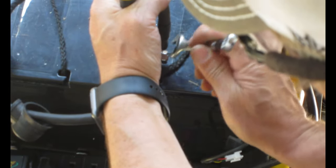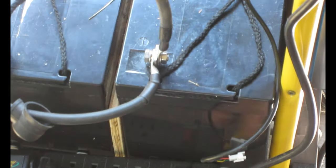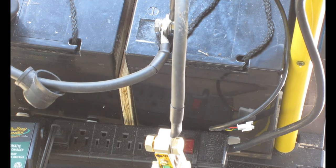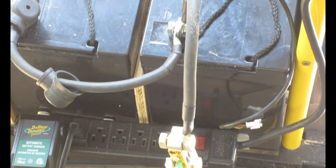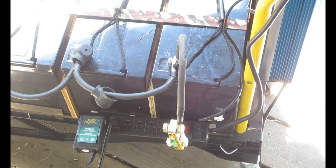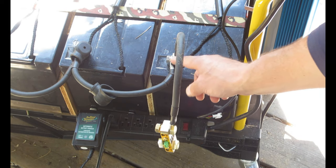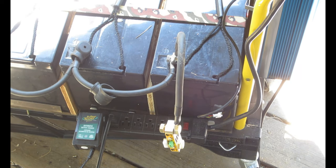I don't want it to come in contact with anything on the box. I'm going to zoom this out and hook that sampler shunt onto the negative battery side terminal. I had to do it that way because the bolt that goes through the shunt does not match up to the lugs on my battery, so I had to drill out one of these cables rather than drill the terminal itself.